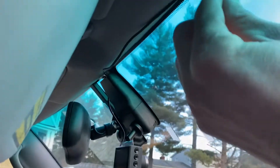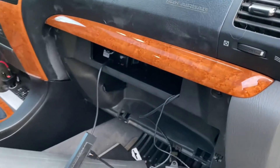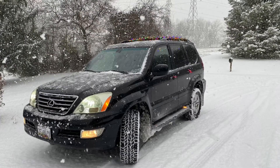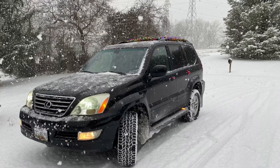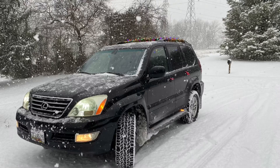For this wire, I couldn't get it to stay up — it kept falling right back out. As much as I hate it, I thought I might just use a little bit of electrical tape temporarily. But I actually got the wire tucked up in there without any tape. It does come out a little right there and a little right here, but it runs down the side weatherstripping and underneath, coming out this hole here. As a quick disclaimer: I later realized that tucking the wire down the side pillar along the weatherstripping means it runs along the side curtain airbags. I'd advise against doing that, because in the event of airbag deployment it will launch out the wire. If you choose to do so, you're doing so at your own risk.